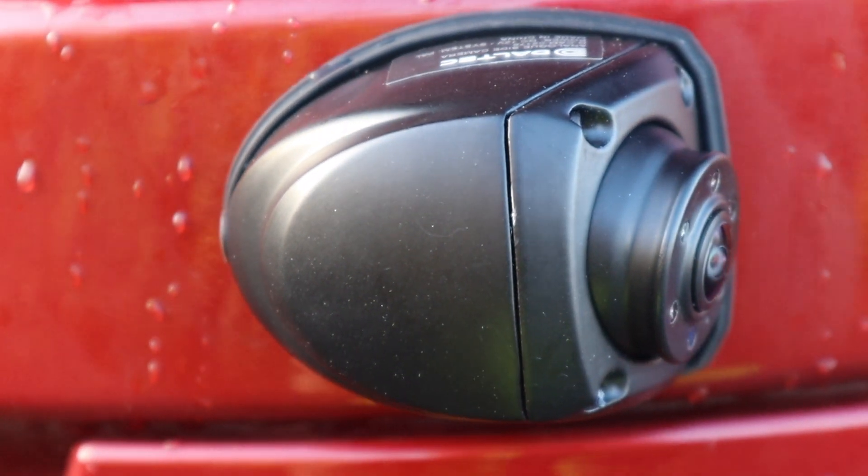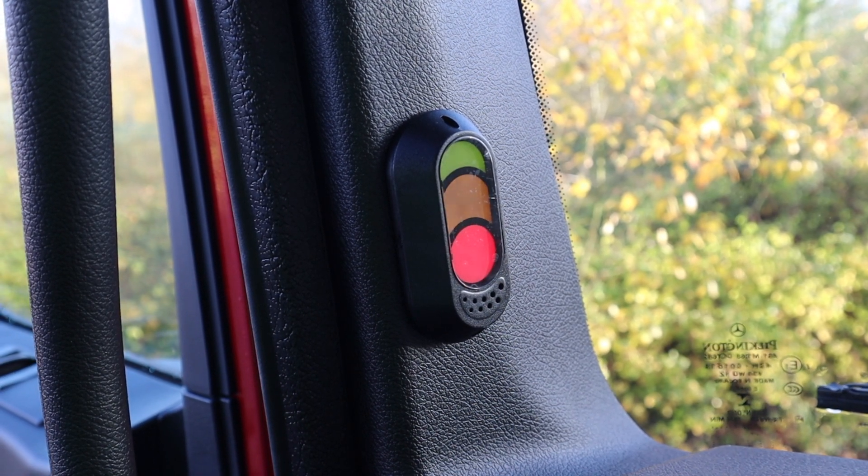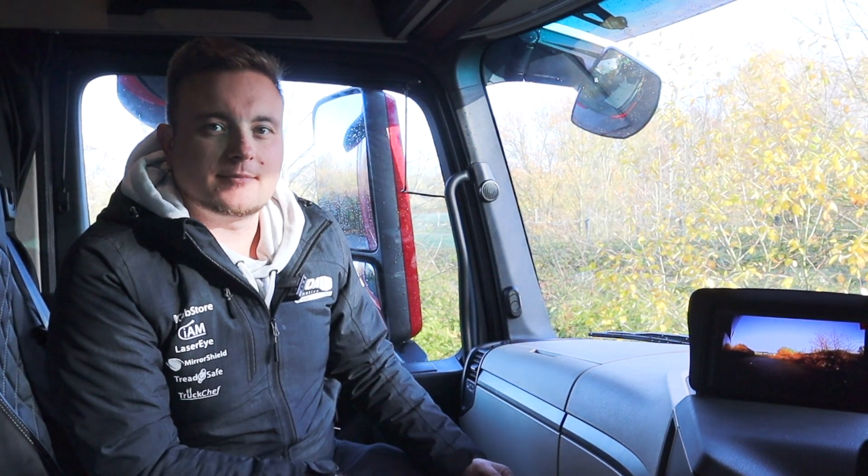It's all down to preference and what different operators want. A brief overview of DVS if you don't know: it's a nearside camera, nearside sensors that go down from the front corner down to the mid lift axle. There's a left turn alarm — that went off absolutely perfectly on time, so that's great. It's all speed-relative, so if you're under 12 miles an hour everything is active. If it's not detecting anything the alarm won't go off — if you indicate left it will say 'warning, vehicle turning left' once, but it won't keep repeating like a lot of systems do. If the sensors do pick something up, then the warning carries on continuously.